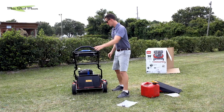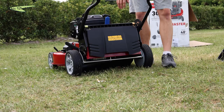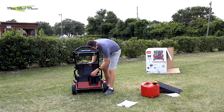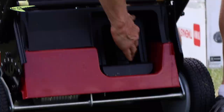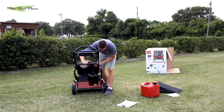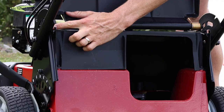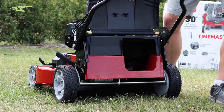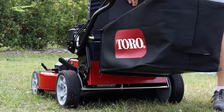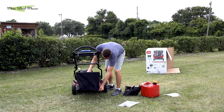The other way to run this is as a bagger. When bagging, leave your side discharge chute closed and remove this plug right here. There's a handle that fits your hand and a thumb release. You pull the plug out — the blade rides by that hole when it's in. When the door is open you'll notice a little slot here and here, and your bagger has a little ear sticking out here and here. You set it in like that, the door sits on it and holds it in place, and once you get grass in there the weight sags down and holds it in as well.